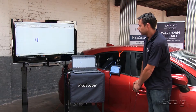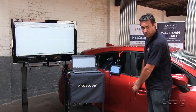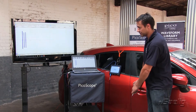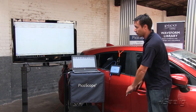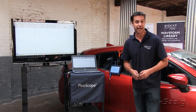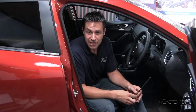What you may find is that there are different points on the door handle that will actually transmit at a higher frequency. One of the useful things about the keyless entry detector sensor is that you can actually pick up where the high points and low points are on the handle, which can be very useful if you're looking to diagnose certain faults you may have with the transmitter itself.